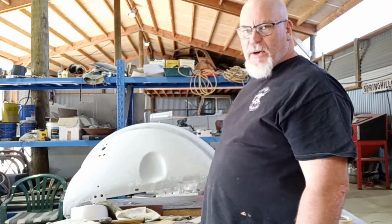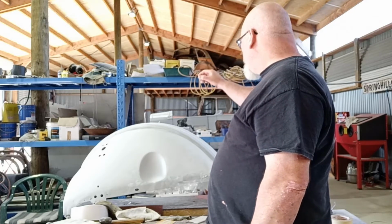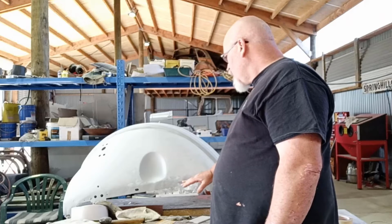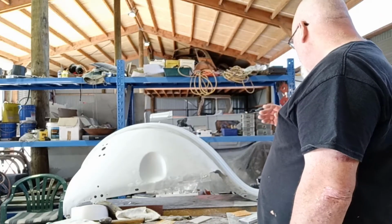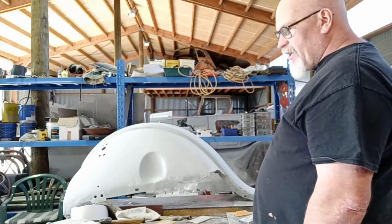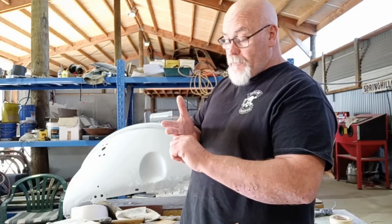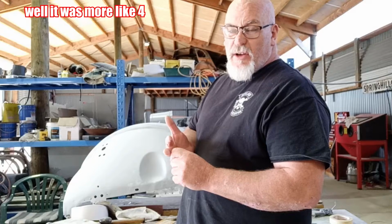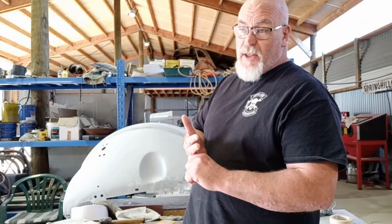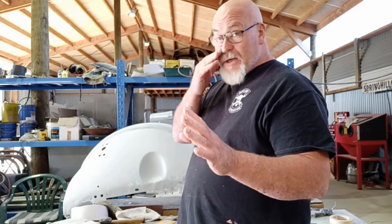I'm trying to get these front guards dialed in, or fenders, and I'll have another quick wee look at the back ones and double check any little funny spots in them, and just get anything that I know is going to be seen sorted. Try and get all these last little splits with a little bit of glaze and putty and knock them off, and then hopefully what I'll plan to do is put 2 good thick coats on, and then let them dry, and then I'll rub them back again, check for any last little marks, and then I'll put another 2 coats on, and then I'll let them sit until ready to paint them black, hopefully. As long as I don't find anything else that's annoying me.